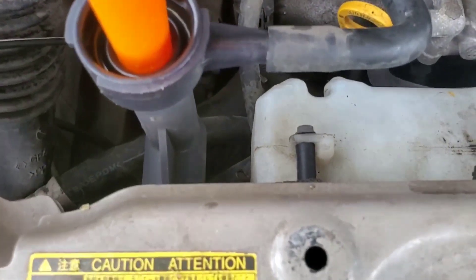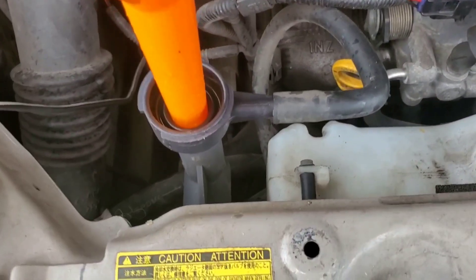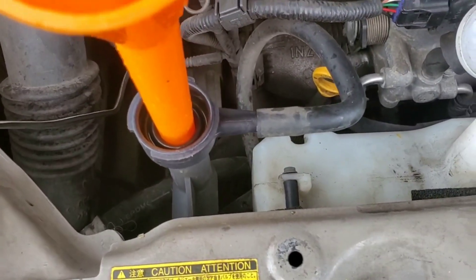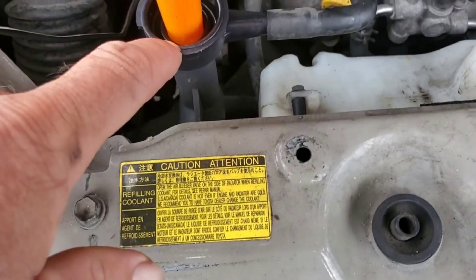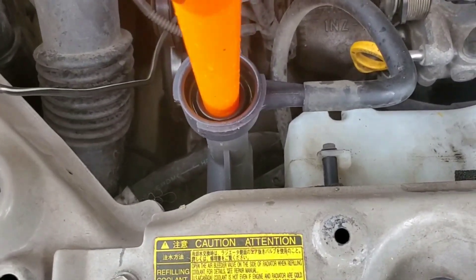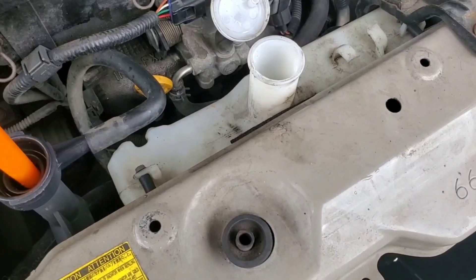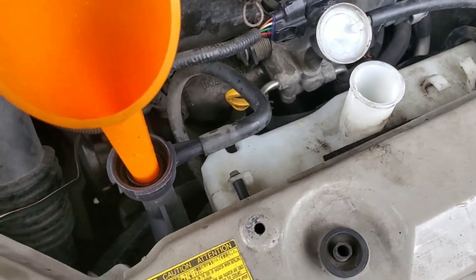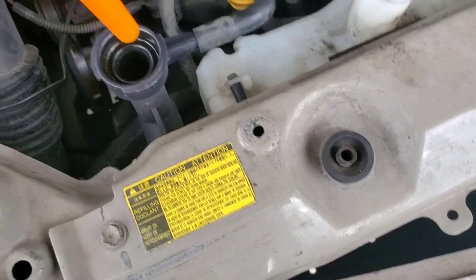These systems are hard to burp even for a technician — they might have a fancy way of forcing the pump on and purging air bubbles, but even they have a difficult time getting all the air out. So: start it up, leave the cap on for safety, let it circulate, turn it off, come back when cooled down, and add more. One trick is to fill all the way to the top to create a little pressure. You could also put o-rings on the funnel and jam it down in there to create a height and pressure difference.